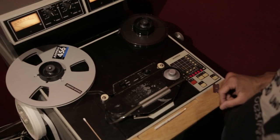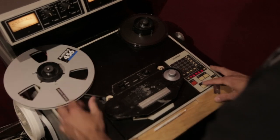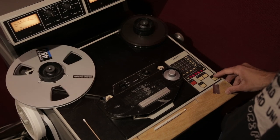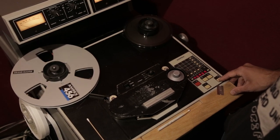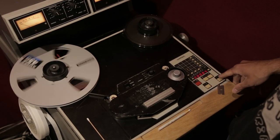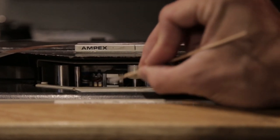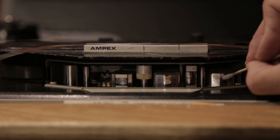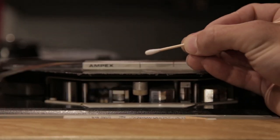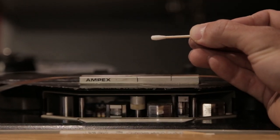If your lifters and the rest of your tape path are clean, you can go ahead and re-establish tension on your tape, then play back a short section — maybe 50 to 100 feet — and then wipe your heads with alcohol and check for any residue or tape pieces that have shed off on your q-tip. If they have, it's time to bake the tape; if not, you're good to move on.